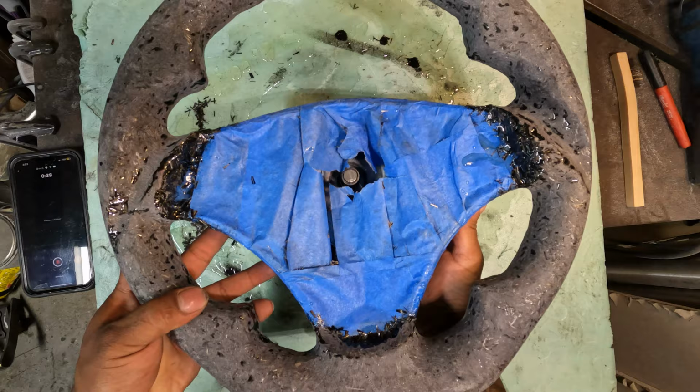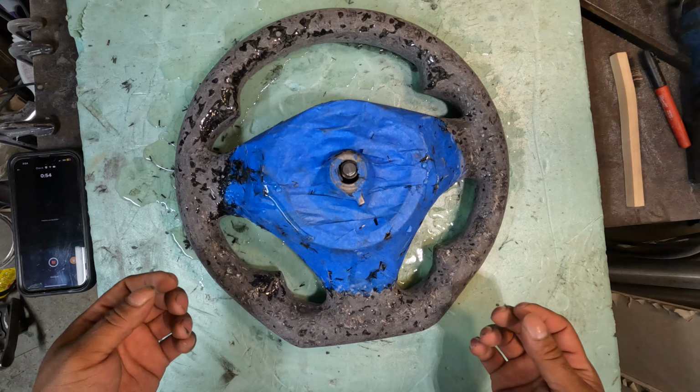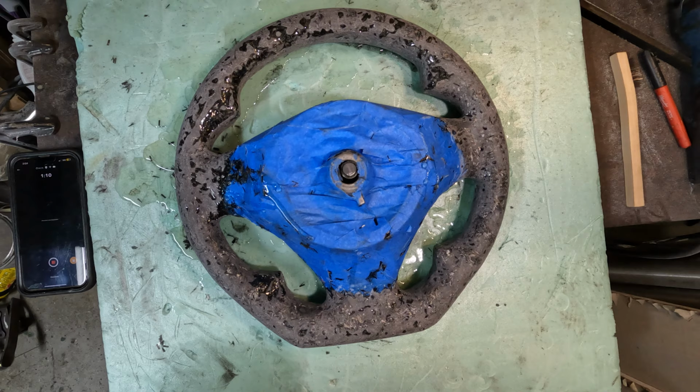Let's do that now. So over here, we're gonna put our epoxy. We're gonna put a light layer just to build up the low spots. We're not gonna soak it, because when we do the other side, resin is gonna drip down, so it's gonna build on itself. So we're gonna put a light coat back here. We're gonna put a little bit of carbon on the corners that we're gonna build up again, and then flip it to the other side and just apply epoxy. We're not adding carbon to the other side. So we're gonna go back on time lapse, and then yeah, let's get it.